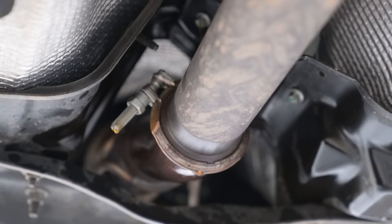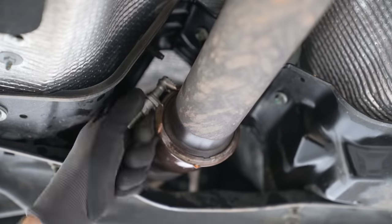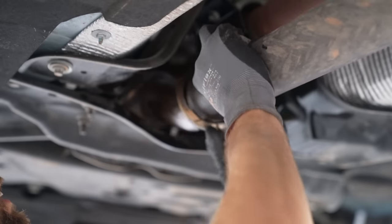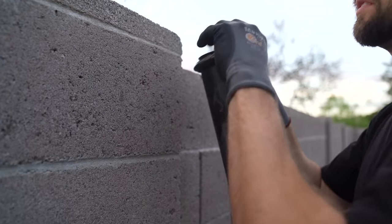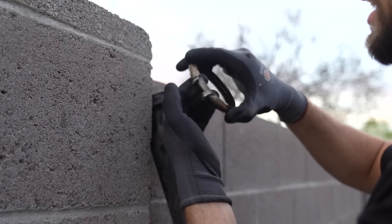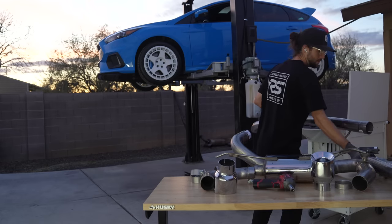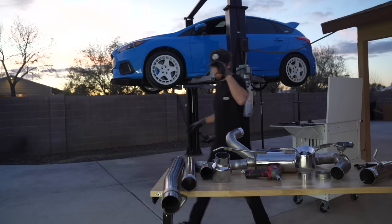Only thing left is the rusty v-band — looks like it's a 15mm, but it's a 16. The nut is completely off the v-band; pull the bolt out. There we go — separated. I'm going to slide this all the way off. There's like a center piece that has its own little spot. I can get this hanger off while I'm at it — you can really see how the tool works. Nice. Mid pipe with the pipe that connects to the downpipe — three inch clamp.